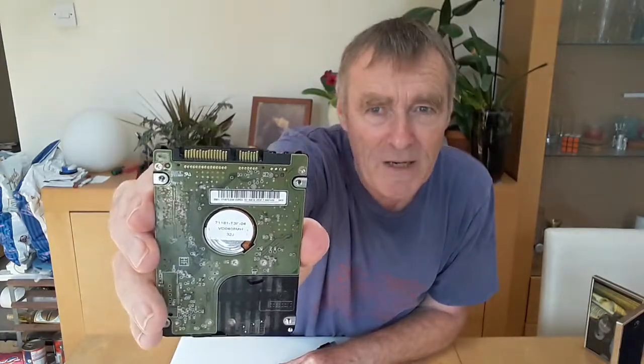On this device, you'll notice on the end there is an adapter, and this matches up with the SATA connection on the hard drive. If you look closely, there is a notch, but it's not in the middle — it's slightly offset. This is to prevent you attaching the adapter the wrong way around. So in order to use it, all you do is match it up with the notch like that, press, and voila.